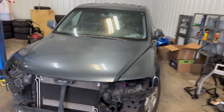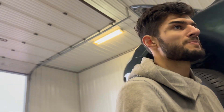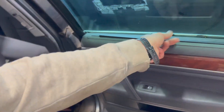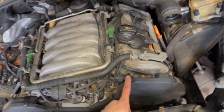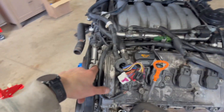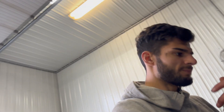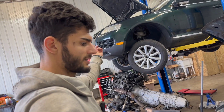Here she is. I don't even know what year it is — I assume it's an '04, might not be. This is a V8 with air suspension, just like mine — basically the same spec. It is missing the roof rails. The previous owner bought it, used it for parts, sold some parts, and basically just needed to get rid of it. We got them with the window shades. Theoretically we have a perfectly good motor — the timing belt was changed not too long ago, but we are going to need to do the chains. I might just take them out of this engine since they're pretty new. These tensioners are in pretty good shape; they were replaced by the previous owner. The previous owner messed up the timing job, I fixed it, and then found out it also has oil pressure issues. So we're going to pull this motor, swap the chains, and put it into that. As simple as that.